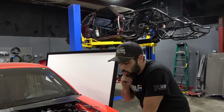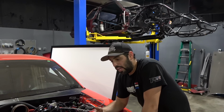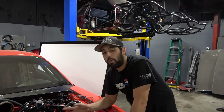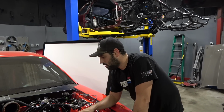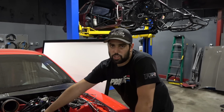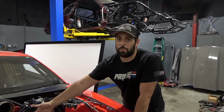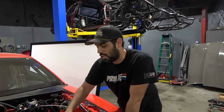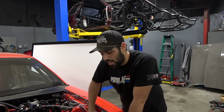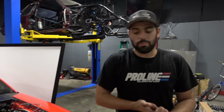motor. So when we started pulling things apart, which honestly, if you're going to buy a race car and intend to race it competitively, you probably should pull it all the way apart and go through it and do stuff to your liking. There were some things here, like the starter wire being extremely too small, you got to start the car to race. That failure really pissed me off. Everything in the harness is grounded to one cylinder head. You can't do that. There were some fittings that had issues, just some layout stuff that had issues, and then obviously the motor was crashed.